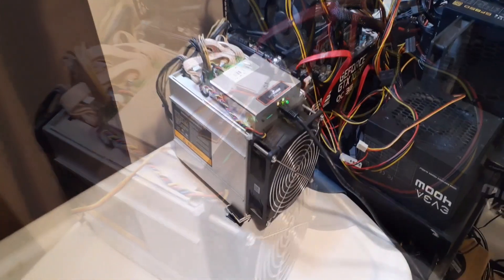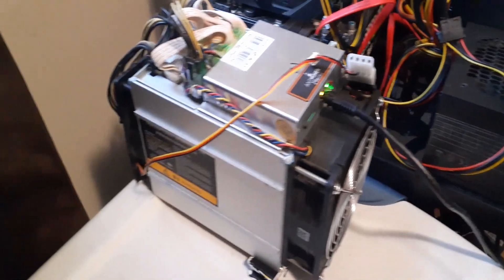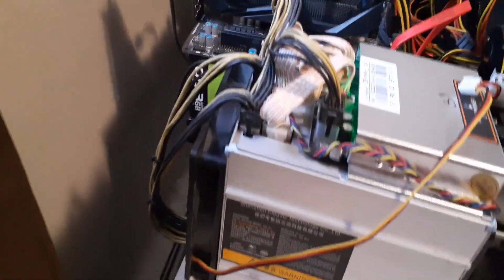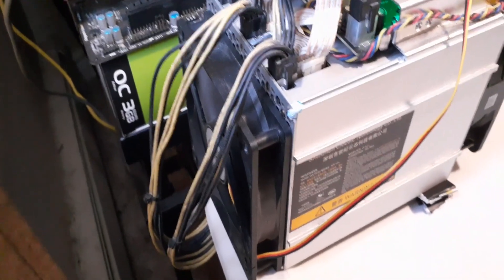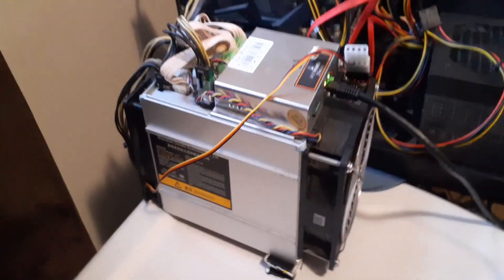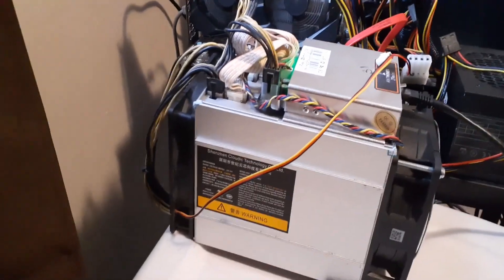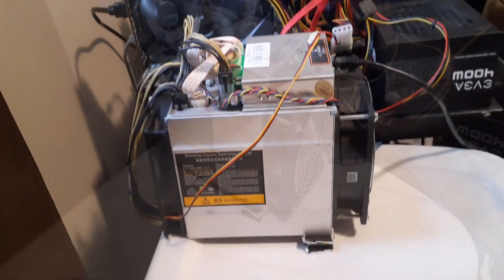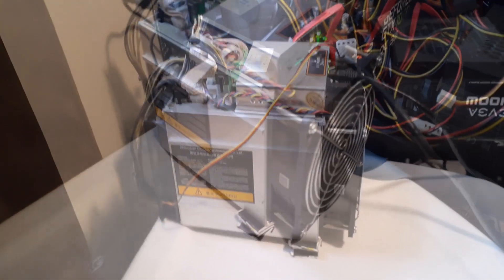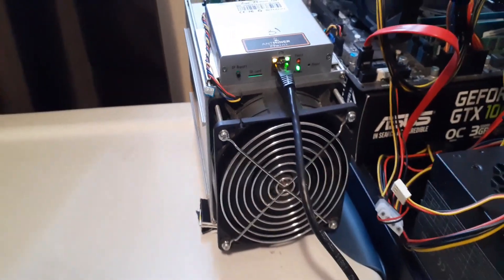On noise level, you can reduce the fan. There's a setting on the Antminer dashboard — once you get it up and running you go to an IP address and configure all the settings. There's an adjustable fan; on default it runs at 100%, which is about 75 decibels — fairly loud, definitely going to cause some racket in a small area like an apartment. I have mine cranked down to 40%, and being in Canada with cool air right by a window, it's nice and quiet.